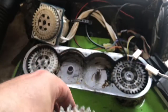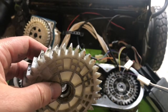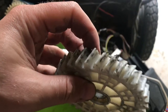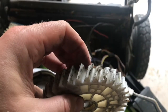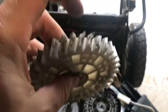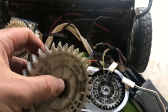In my case it was a root off a cedar tree that was coming up out of the ground — I was mowing a little low. The root caused the gear to jump, and as it jumped it pulled some plastic along with it. So I will file that off and there will be a little less tooth engagement, but hopefully if I don't attack more roots then it'll keep lasting me for more years.